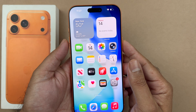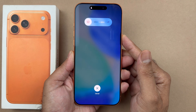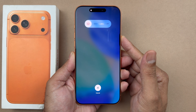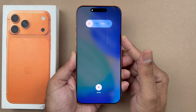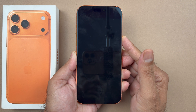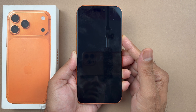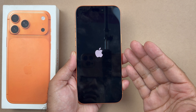So it's going to be volume up and volume down quickly, and then press and hold the side button — I try to avoid touching the screen. It's going to say slide to power off; just keep on holding that power button until the screen goes black, just like that, and once the Apple logo appears let go of that power button and that's going to hard reset your iPhone 17 Pro Max.